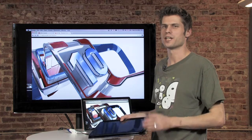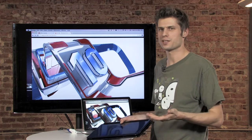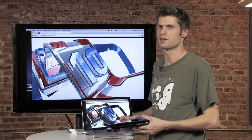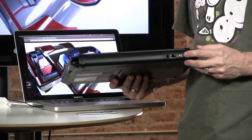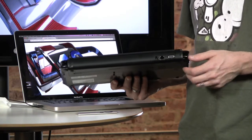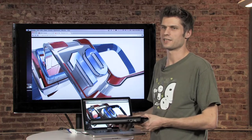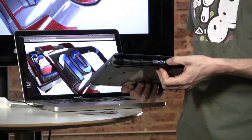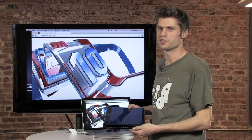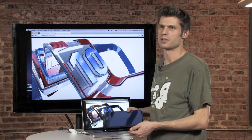The first thing to think about when connecting your computer to your television is what kind of adapters and plugs you need, and how to do this physically. A lot of computers traditionally have an RGB output — this connector here — which you plug straight into your television to get video. But it doesn't deliver sound, so you also need to connect audio either straight to your television through the audio out headphone jack, straight to your home entertainment system, or through extra speakers.